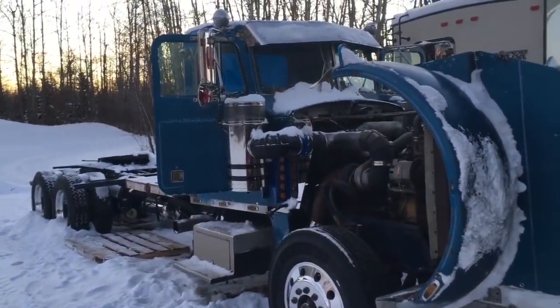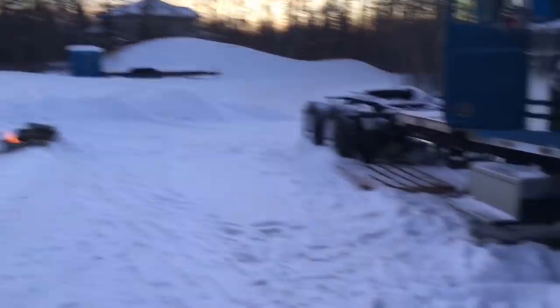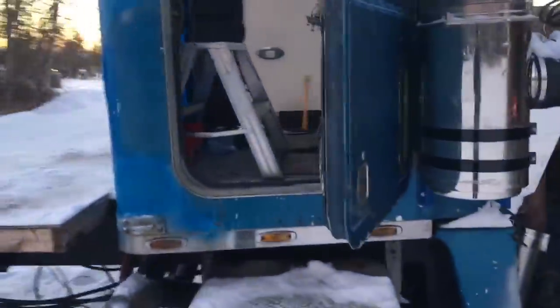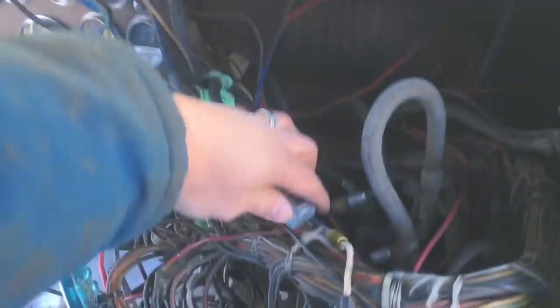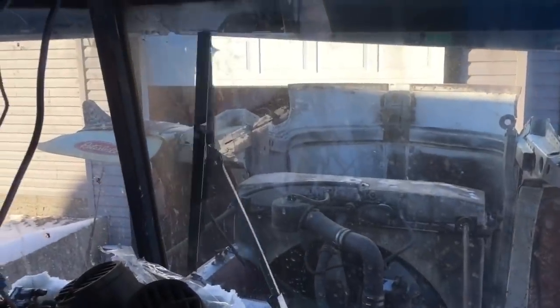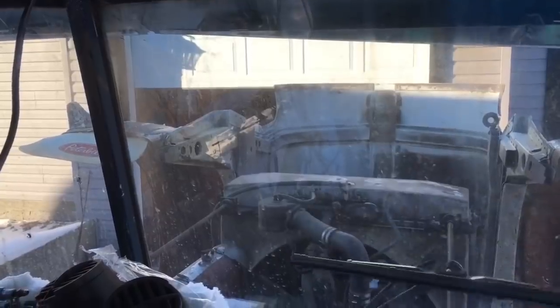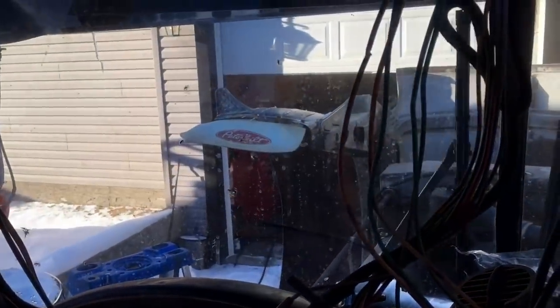Continuing to grind away on the old girl. This morning's about minus 18, minus 20 something with the windchill. Got the furnace going, swept up all the snow, and now I'm going to start going on the inside. I'm going to try and get the windshield wipers working today. Got the new actuators from Dirks — going to put them in here, then we'll air up and see what happens. I plumbed in one of the new actuators and put the new wiper blade on there. Just like new! Let's try the other side. Right on.